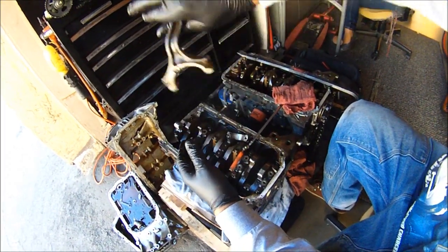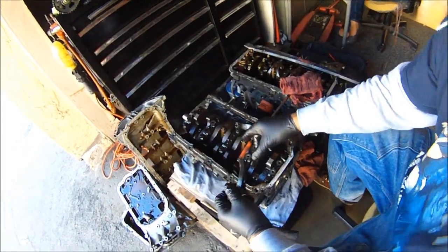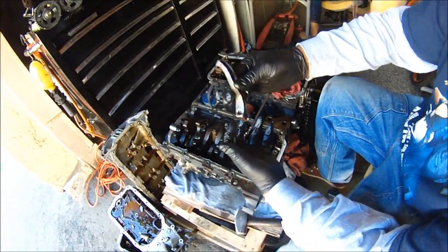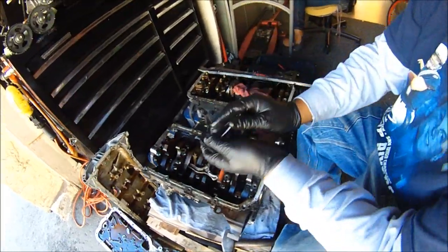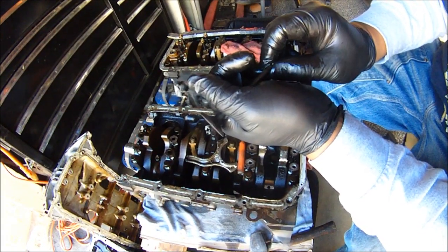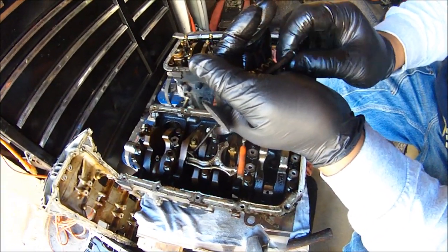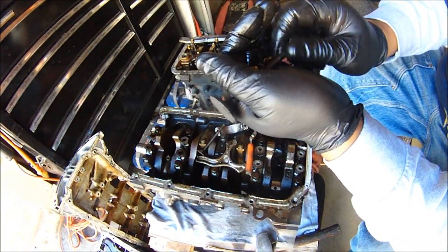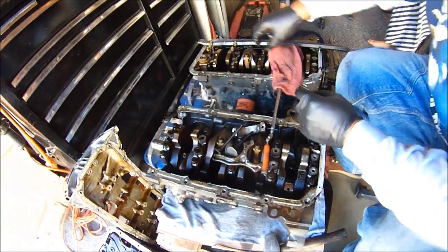It dangles as it goes up and down with the piston, finally gets caught on something and just snaps right off. This piston was stuck at the top. Good thing this didn't stay on and damage the valves too much. I'll show you the valves that bent — they're right here. These are the two valves that bent. Look at that — there's one of the intake valves right there. These are bad, big time. This hit the top of the piston.